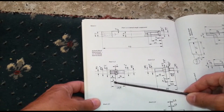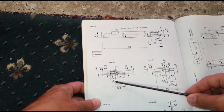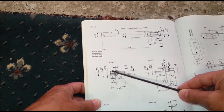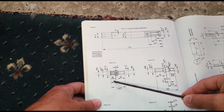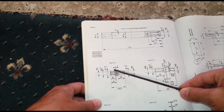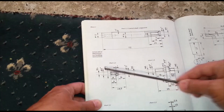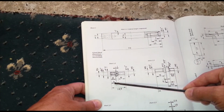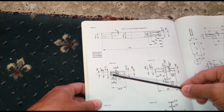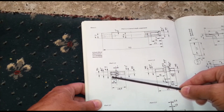Also, to aid location and give you more area to fit things on better, this 9 milli diameter here — 8 for your compressor wheel — make that 11. So the 9 milli area of 8 milli diameter wants to be 11, and that just means there's more location area for the compressor wheel, so that stops that wobbling.